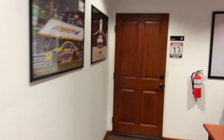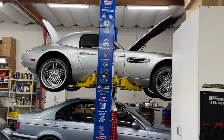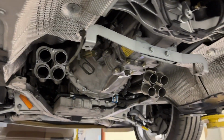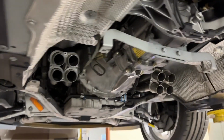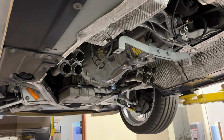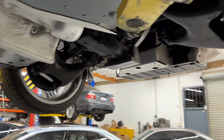We're doing headers, the complete exhaust from the exhaust valves back to the tailpipes, and it's well underway. Okay, we'll sneak in here over Silverstone. So that's a Super Sprint exhaust installed at the headers with fresh gaskets, same as the M5, just S62 gaskets. These are going to be 4-1 headers. So that's kind of the hard part. Now it's a matter of trimming the cat section and then the resonators and then out to the mufflers.